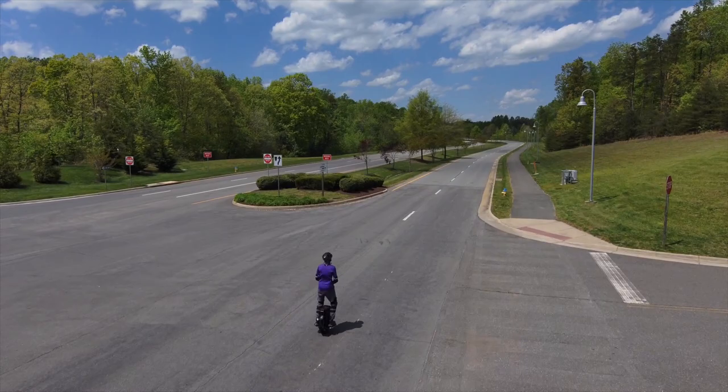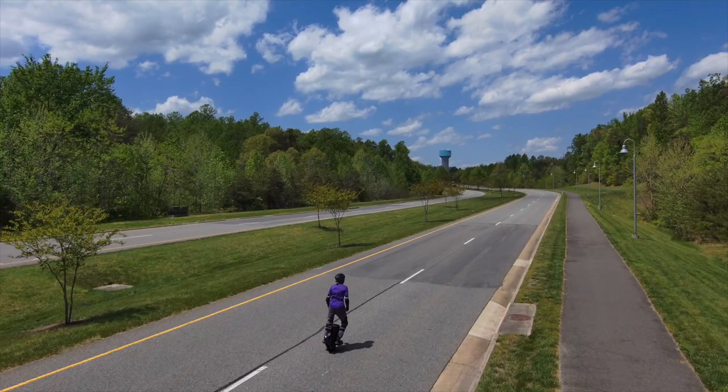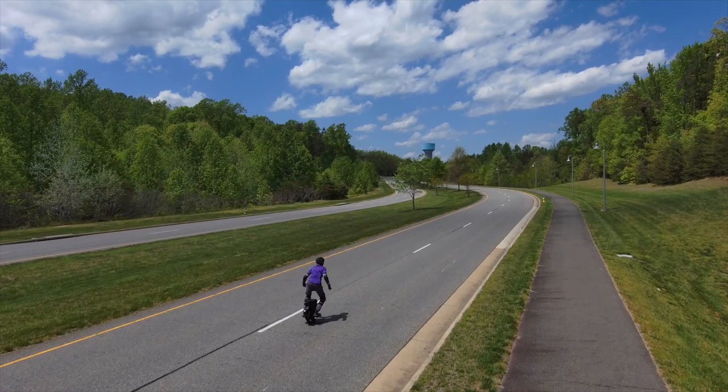Lastly, the Samsung 50E battery outfitted on this particular Master is not designed for continuous speed but more so for range. And even knowing this, the range in my opinion isn't the best. Riding between the high 20s and 30s with bursts of 40-plus miles per hour thrown in for good measure, at my weight of 135 pounds geared up, I was able to get shy of 50 miles — more like 47-ish.